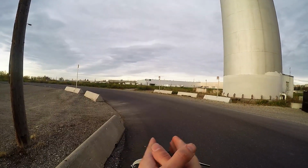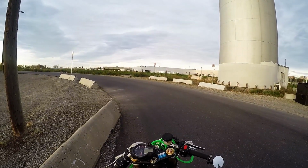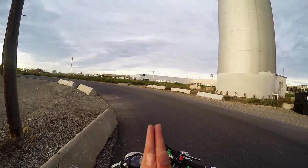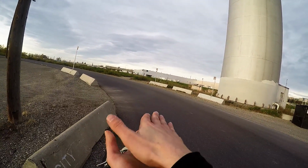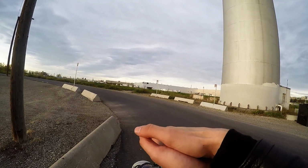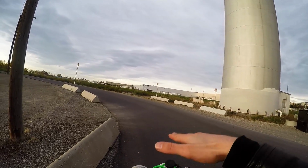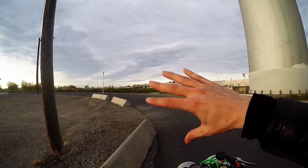And secondly, they actually designed the frame of a MotoGP bike to flex torsionally. So it's really strong this way, so the suspension can do its job. But when the bike is over on its side, I hope you can see this, the frame actually becomes the suspension, and it actually provides the flex for the tires to track through the bumps.